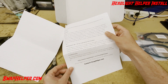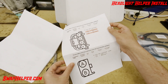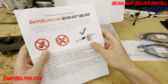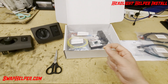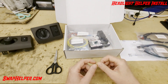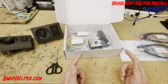The instructions provide part numbers for the sunload sensor and for the pigtails if you need them. They also include diagrams of each headlight switch for each year model, so if you have questions about a particular circuit, you have a reference. The pinout for the sunload sensor is also provided, which is the same from 2008 to 2016. Something to note: if your truck originally came equipped with auto lights, you will need to use your original sunload sensor in the front of the dash. You can't use the 2008-2010 one — you'd have to modify the housing. The 2008-2016 sunload sensor is only used if your truck did not have auto lights and you're retrofitting it.